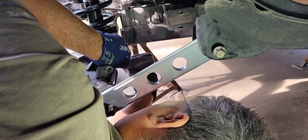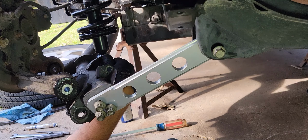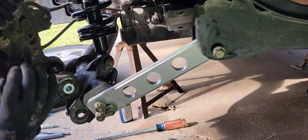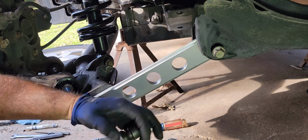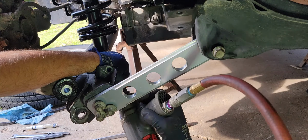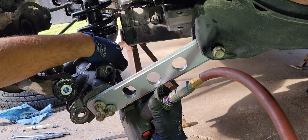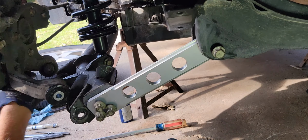See where we're going. All right, there we go. Just gotta get the very bottom of that strut. Now you'll notice that with all struts, there's a little bit of torsion in there sometimes when they put it together. It's not perfect, so you have to turn a little bit at the bottom. That's just what I did just now. Started in there. Okay. That little feller started. Get this to go in a better spot.